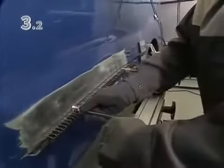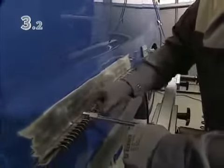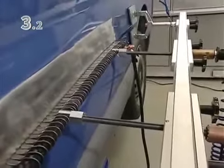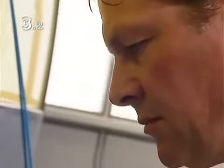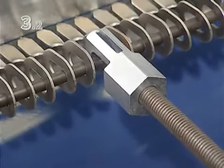Set the hooks to the optimum pulling points and adjust the puller. With the Flatliner system, up to two pullers can be mounted simultaneously on a pulling bridge. Ball bearings on the pullers allow fine adjustment of both pulling and straightening.